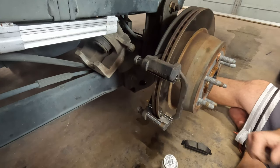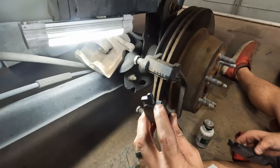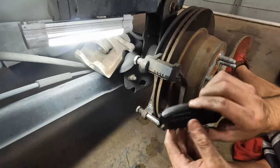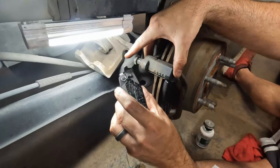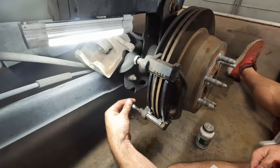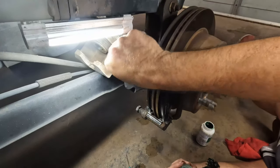You don't need very much — use very little. There's not always an inner and outer; sometimes they're just the same. You want to make sure if you have the squealer tabs, you're offsetting those — no reason to have two squealer tabs on one wheel and none on the other. These are actually labeled inner and outer, so we'll follow that. Better to put the brake grease on after you put the pad on because they get slippery. I'll wipe off the old lube and just throw a little bit on — you can overdo it.